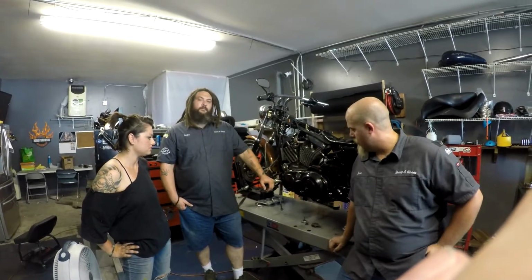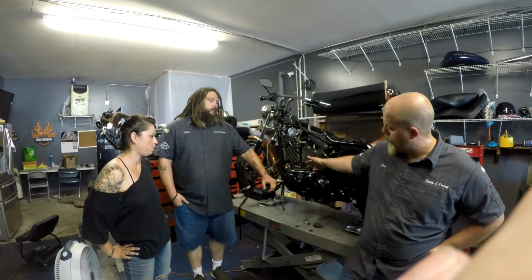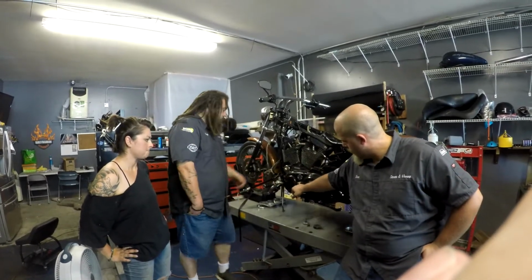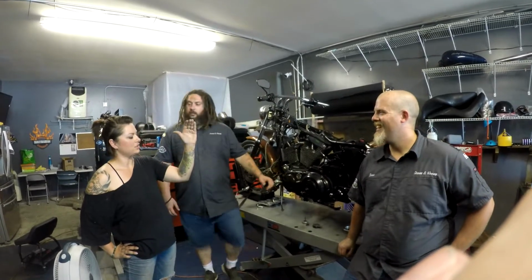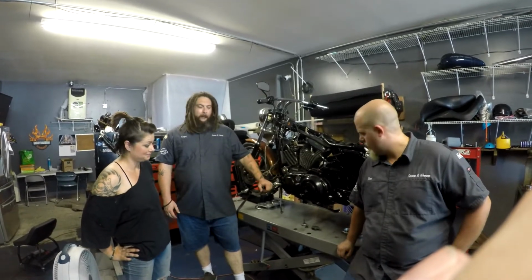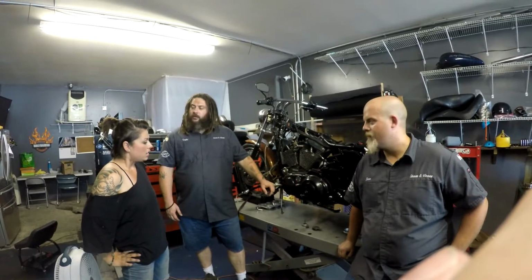And we got the outer primary cover back on. The reason we had pulled it off, we removed the clutch and the rotor and crank sprocket to be able to replace the gear shifter. Where's the old one? It's in the trash. Okay. The only thing was it was curved, and the splines were all jacked up on it. Curved stuff isn't always a good thing. So, tell us a little bit about going in here and replacing anything in here that you remind yourself of.